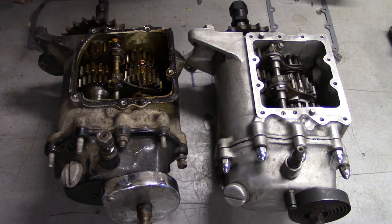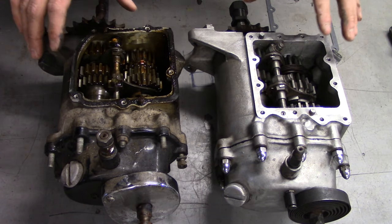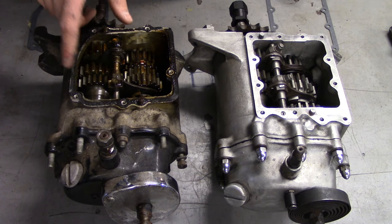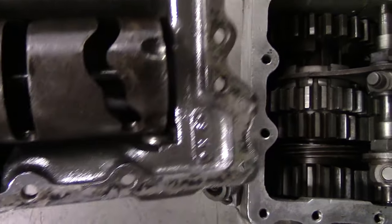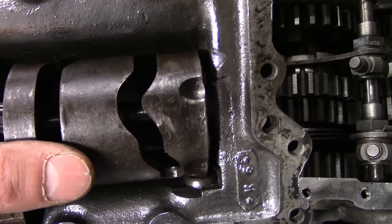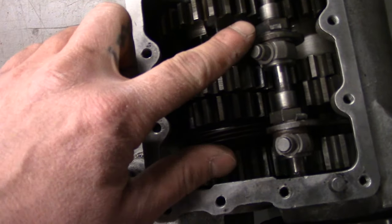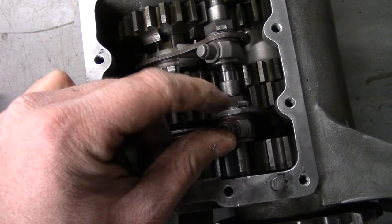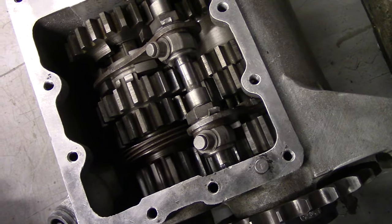The ratchet top will not physically fit on a rotary top. So if you want a ratchet top transmission, you've got to change out the whole transmission, unfortunately, because it's an entirely different casting. Regardless of which top you have, they all basically work the same. These channels in your shift drum — as they move, your shift forks follow them, engaging and disengaging whatever gear you're trying to go in or out of.